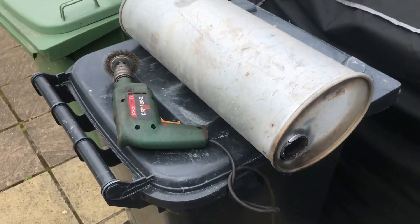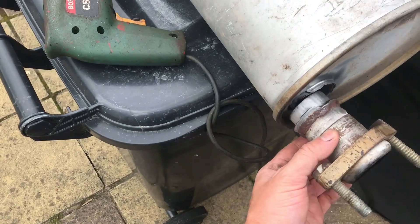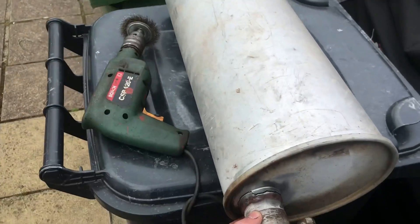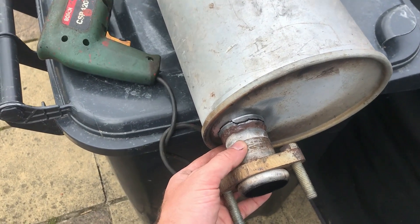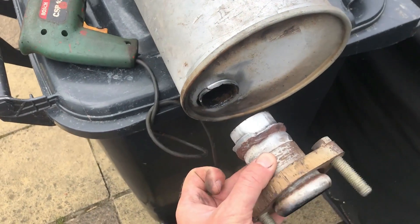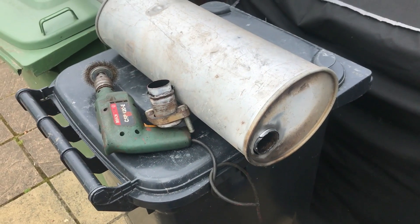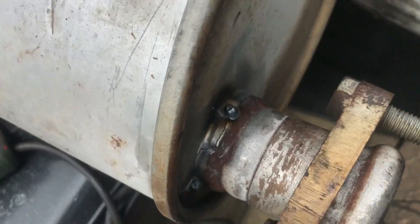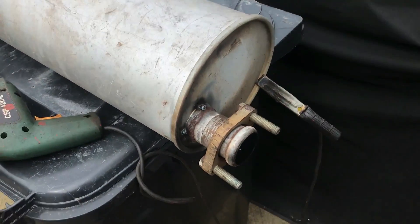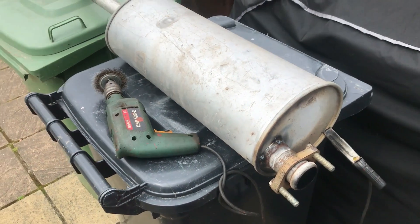Remember that new exhaust I fitted when I got the van? It lasted about probably 2000 miles, less than that maybe. It's fractured all the way around that welded joint, and this is a genuine LDV part - not a Walker or Bosal pattern part. So I'm going to weld that back on and then weld in some reinforcing because it's just the vibration of that clattery engine shaking it apart. It's all properly mounted with rubbers and yet it's still fractured off, so bracing is the order of the day. I've thrown a couple of tacks on to hold it in the right place and cranked the welder up a bit more so it'll actually penetrate.